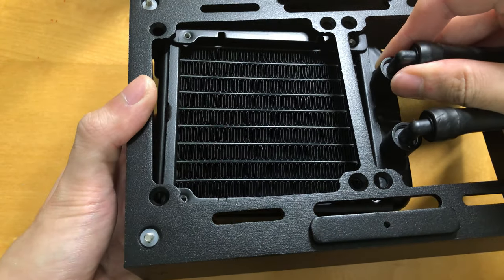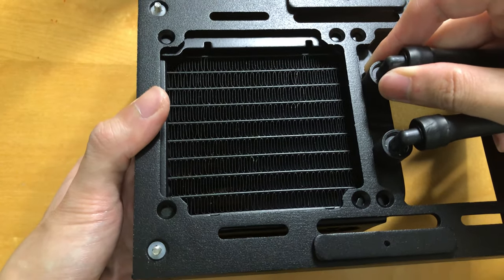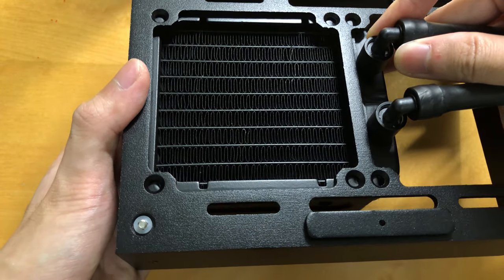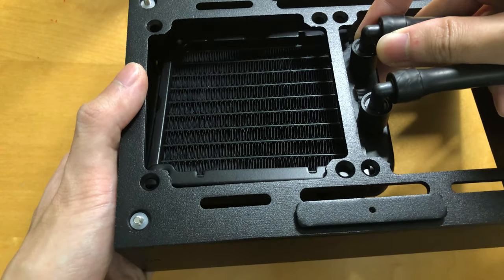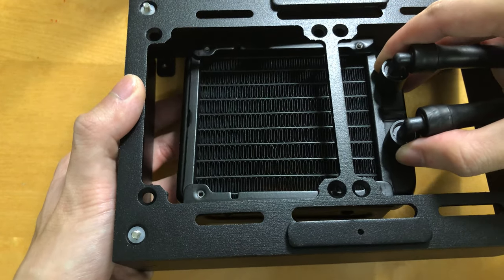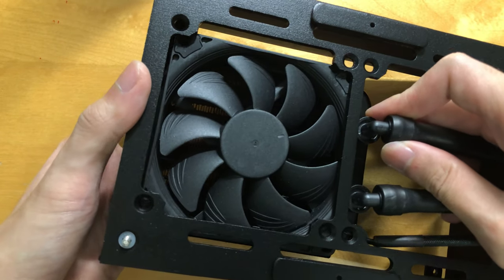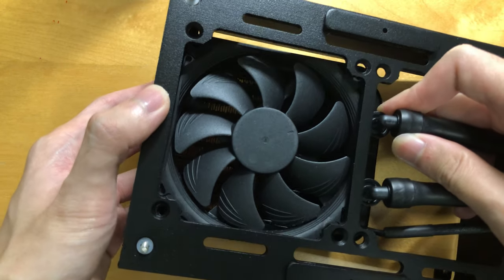In the last video, someone asked me to test this Asetek 645LT in the MI-6 case. I tried to mount it with the Tall Loft, but it would not work. I positioned the radiator all the way to the front, then all the way to the back, but either the 90 degree angle fitting was blocked by the frame, or the rad itself was too big, and the case mounting hole would not line up. I tried with both normal and slim 92mm fans for push config, but they could not solve the issues. So the best for this case would be the 120mm radiator.